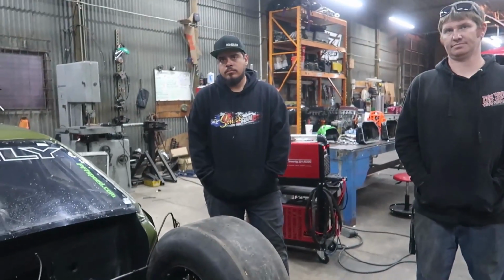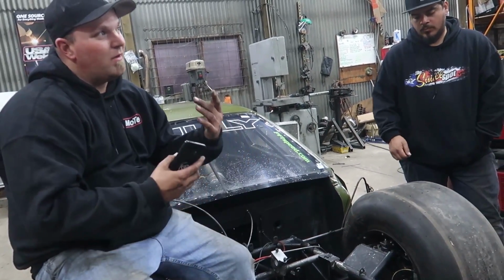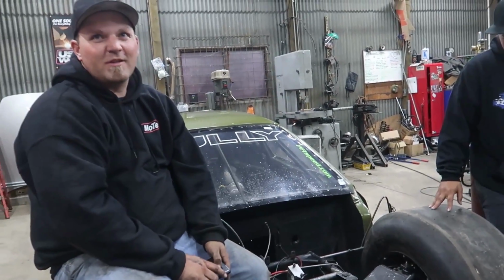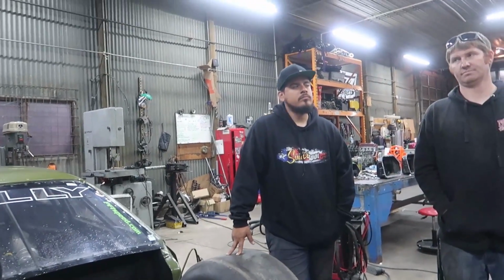You want to do a water to air, or do you just want air to air? Air to air would be really nice because then we've got to work about just a 2 to 1, like a 4-inch core, 5-inch core. Yeah, just a 2 to 1. Me and Sean will look at those tonight, because he'd have to build the tanks to do it right. You can't buy something with tanks. You'd just be buying a core.